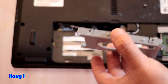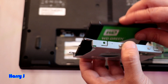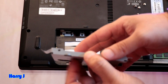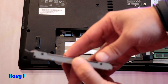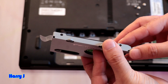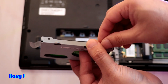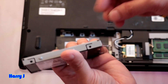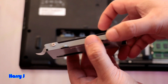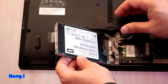Now we have the SSD card. You have to place it the same way as the old drive and tie back the screws. The SSD is slimmer, so when you put the screws in you have to check properly. I'm going to tighten them one by one. The four screws are now tight properly.